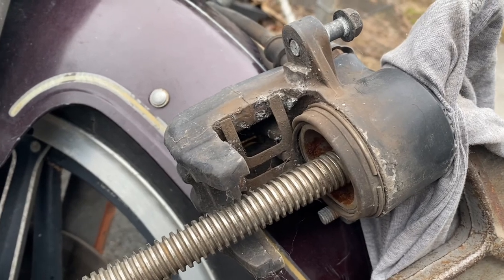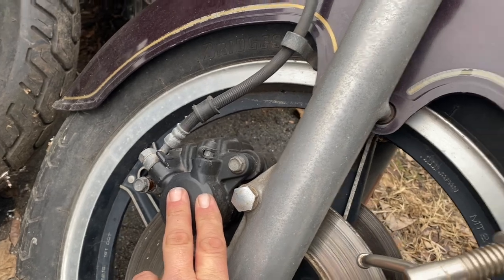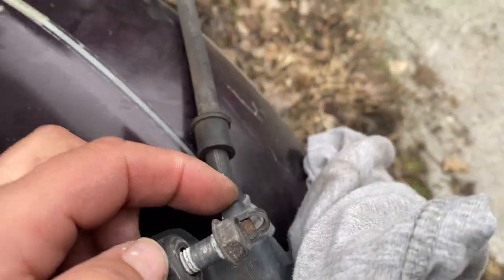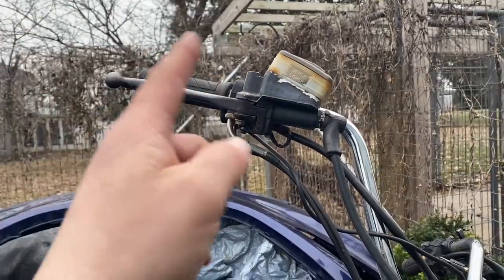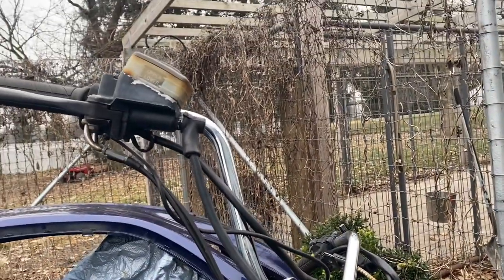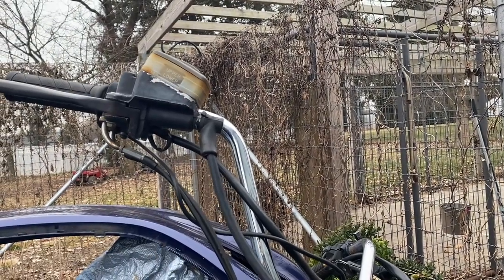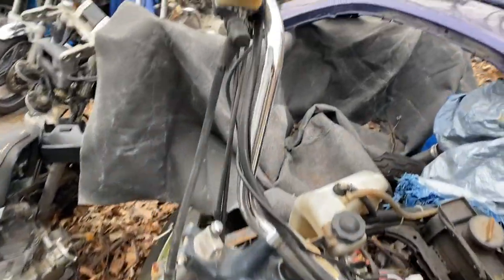Since this is still installed with pads, that's not going to go anywhere. Since this is all the way pushed in and held there, all I really need to do is crack these caps and use this up here to push everything down and out through the system. What I want to do first is open up that cap and siphon out the brake fluid so we're not pushing more fluid down through.